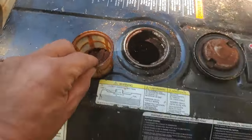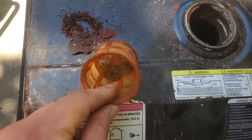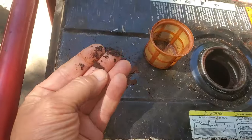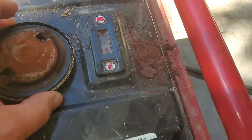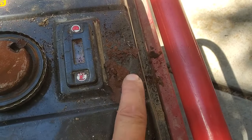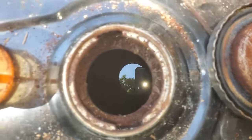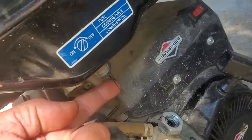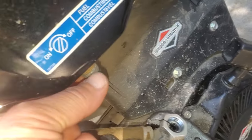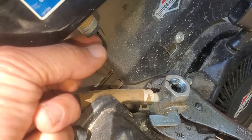Got all this on this red generator here — that was in the cup screen, it's all just rust. I tapped off the inside of the cap there, same stuff. And that just smells really bad down in there, super old gas. And when I took off the fuel petcock, it's got this tar, nasty — see this kind of soft, hard, molasses-like stuff.